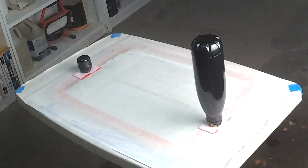So in this case, because I did go with 2 heavier coats and because of what it is, 2 coats is going to be enough. I am still going to do paint work on this as well, so it doesn't really need 3 coats of clear right now. It just needs enough so that when it's hard, it'll scuff out and it'll get cleared again at the end.